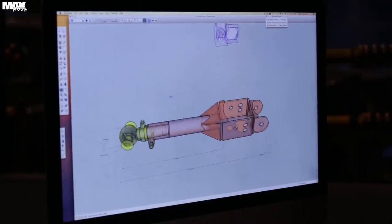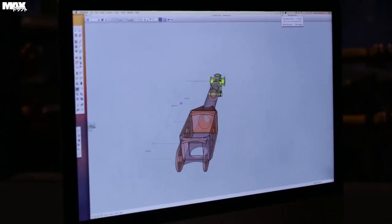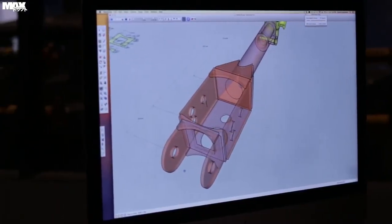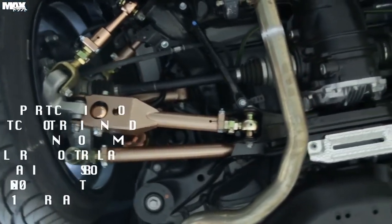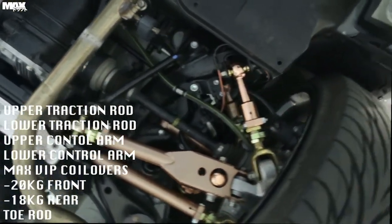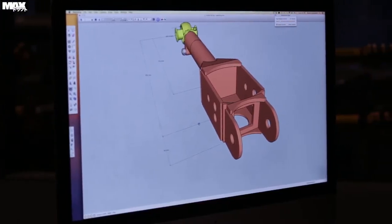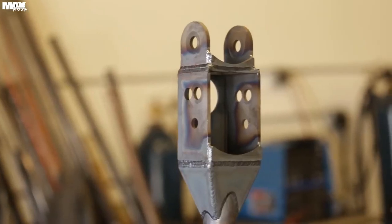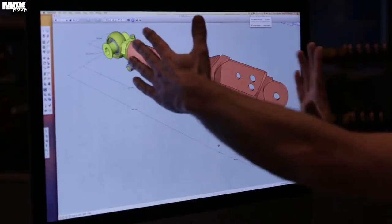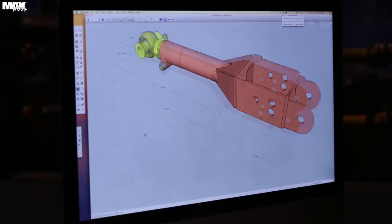So one of the considerations that we did with this particular part is we really achieved a close relationship between where the knuckle mounts and where the coilover mounts. And the reason why we brought those things so close together, and actually had to do some unique work in clearing the relationship between those two things, is because the relationship between where the coilover mounted and the car is, we didn't really have the ability to shorten that anymore, so we actually ended up shortening the two points.